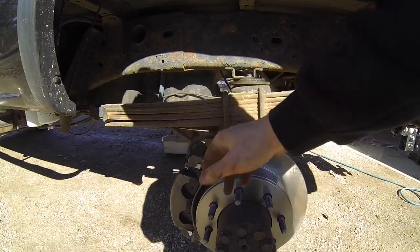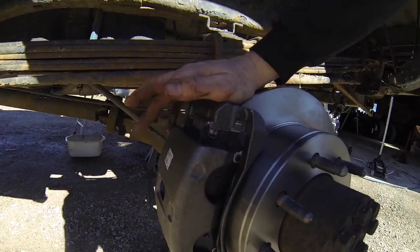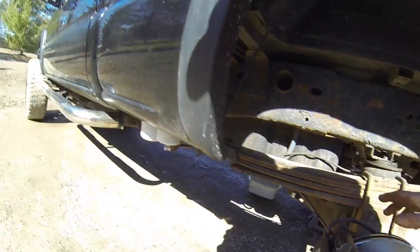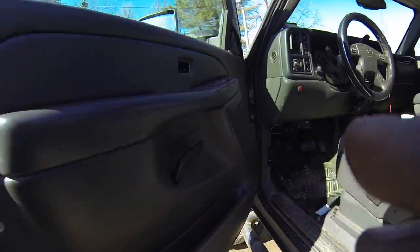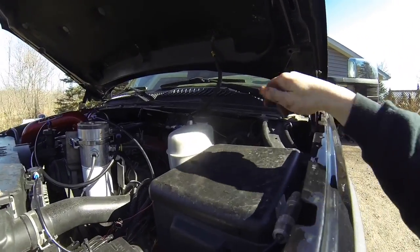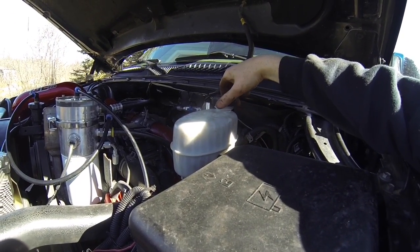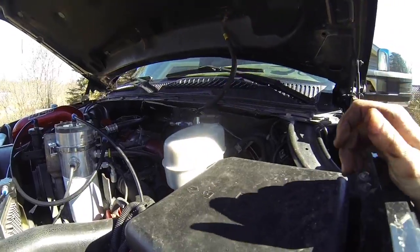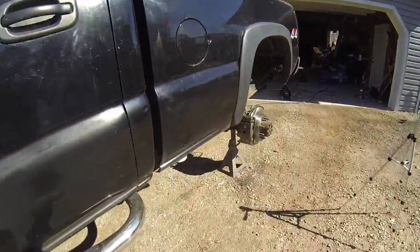So that's very important. Another thing to note once you're actually installing the brake pads, and you got to push the piston back into the cylinder, it's always a good idea to relieve the pressure off the master cylinder. Let me show you. Basically, guys, you want to go ahead and just crack the cap on the reservoir here on the master cylinder. Just crack it just like that, and it'll be fine. Make sure you guys do that if you're pushing that piston back in.